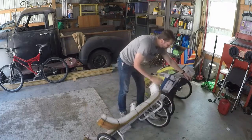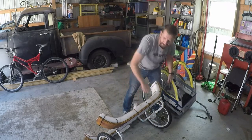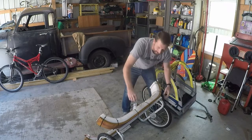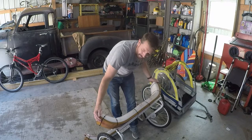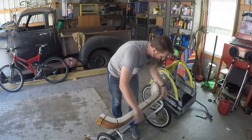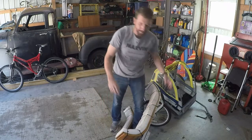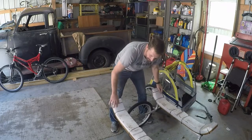That really was able to clear the canoe as it came down. I didn't have to buy any nuts, bolts, parts, or pieces other than the bolts that went through here to hold on this wood trim. What we did is we knew we wanted some foam on there, so we put the foam down. This is two layers of quarter inch plywood, the real flexible kind. We put the foam down on the canoe, then put the wood down over it, loaded it up with wood glue, put the next layer on, and used ratchet straps around the canoe so it formed perfectly around the canoe. The zip ties are the same zip ties I put on three or four years ago and they're still holding up and working fine.